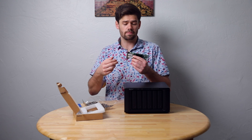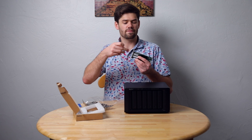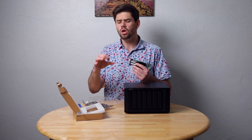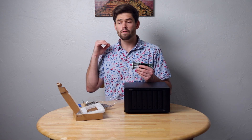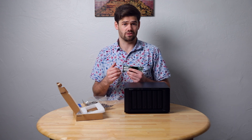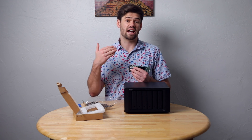Normally when you're dealing with fiber, you would actually have an optical transceiver here that converts the electrical signal into light. That light is what you plug a special optical cable into, which basically just bends the light with very little loss over a very long distance. You can, for very cheap, get an optical transceiver that will go four kilometers — it is so easy for long distances and very fast transmission rates.